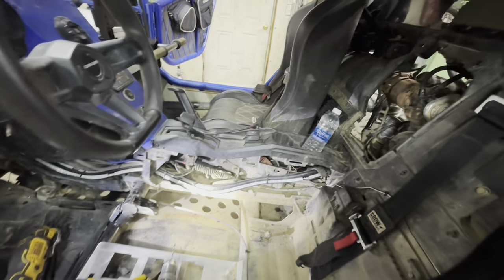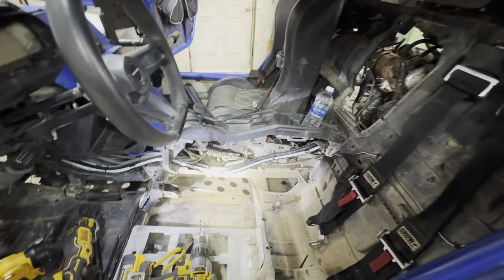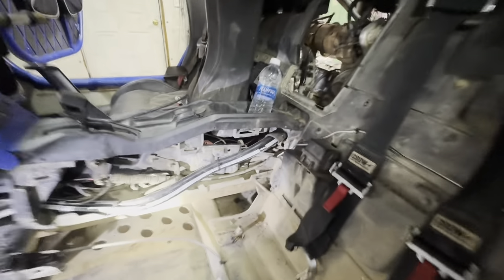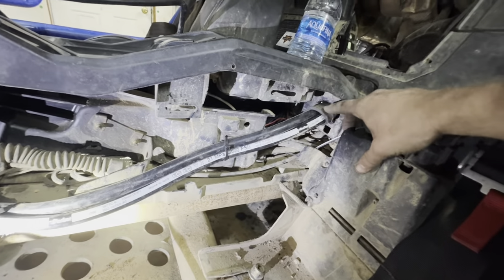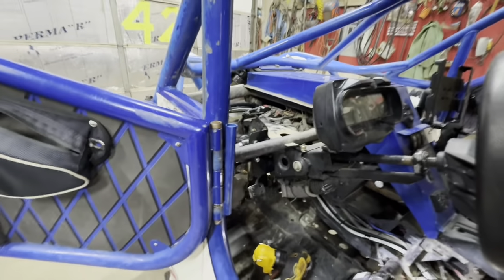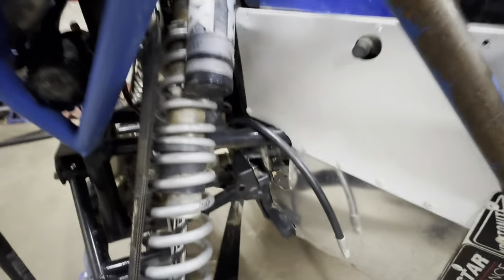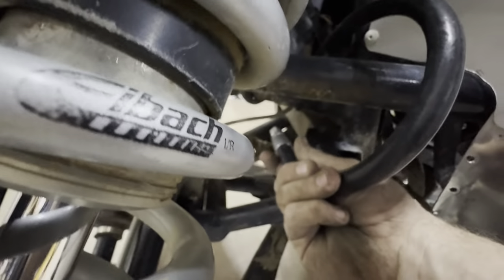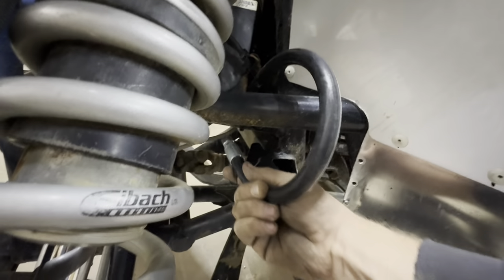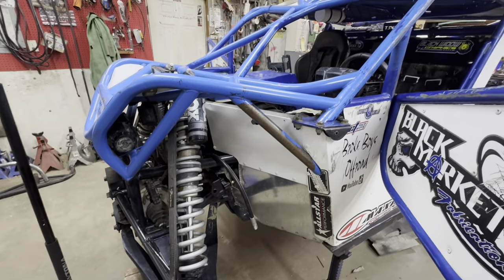The side piece still fits - just had to cut a little bit of a hole in it for where it kicks out around the shifter. I ran it up through here and put a piece of rubber radiator hose around it to keep it from rubbing on anything, got it nice and zip tied down in there. His instructions say you're supposed to loop this line up front, but I have a battery up there so that option doesn't really work. I'm hoping to get the ram in there to be something kind of like that, because this needs to move back and forth with the ram.